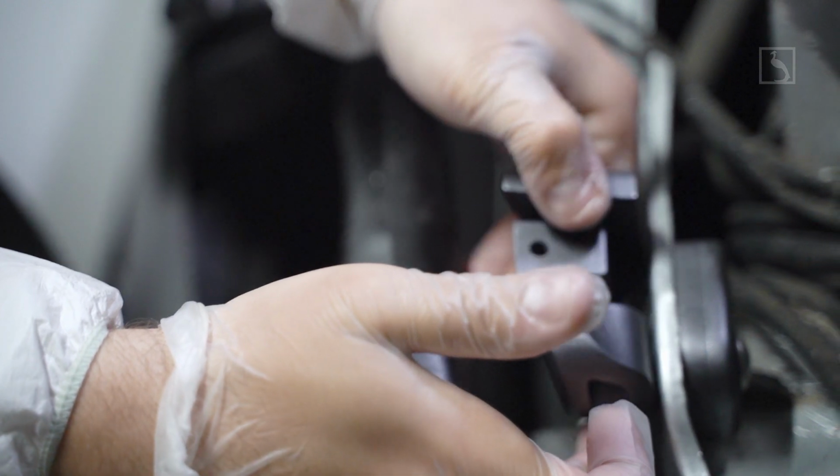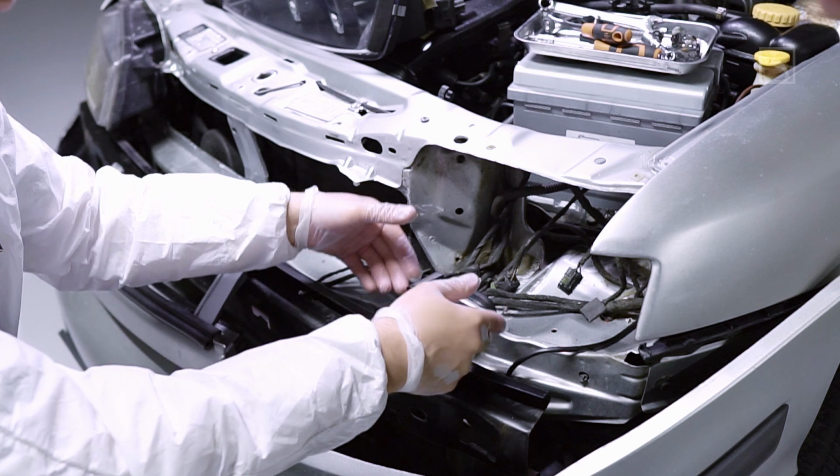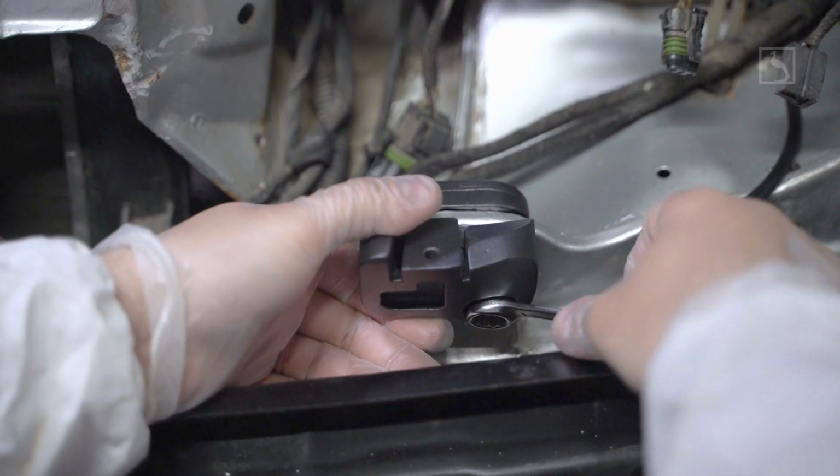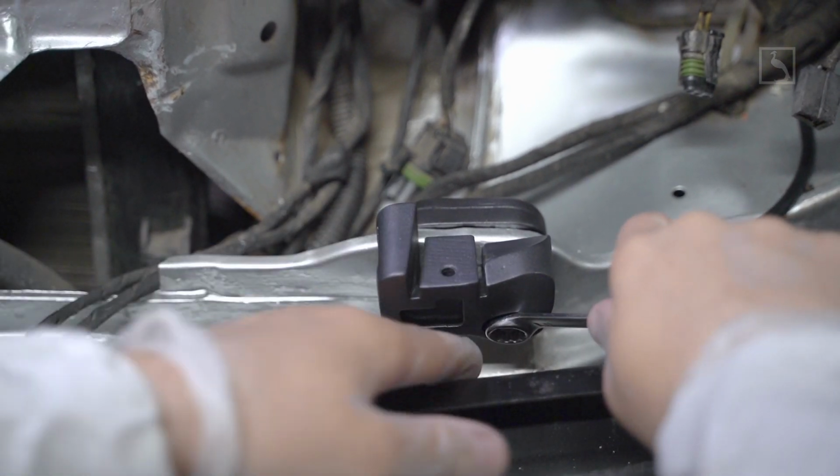After you tighten the 8 mm bolt, check the free rotational movement to be assured. Progressively readjust the nut until the piece stops gripping.